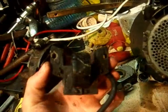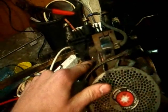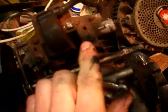If the magnet is weak, do what I said before — buy a second-hand coil with electronic ignition already in it. No matter what your engine is, the only difference between coils is the bolt hole locations. On some bigger engines like this five-horsepower series, the bolt holes are located further into the coil, whereas on other engines they're on the very outer edge.